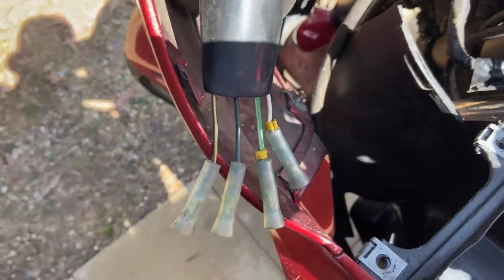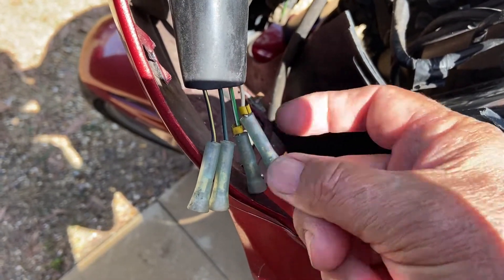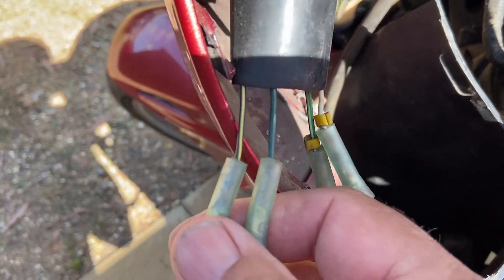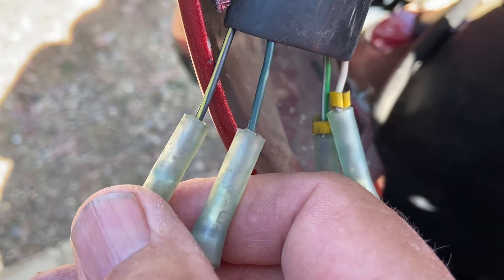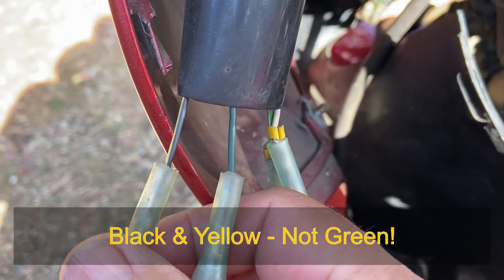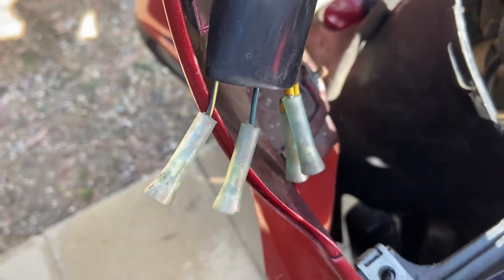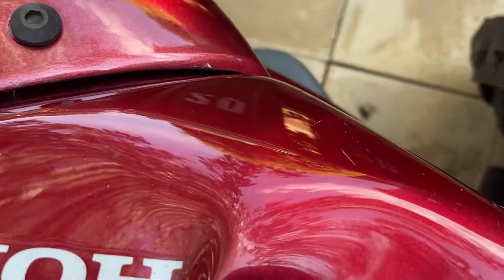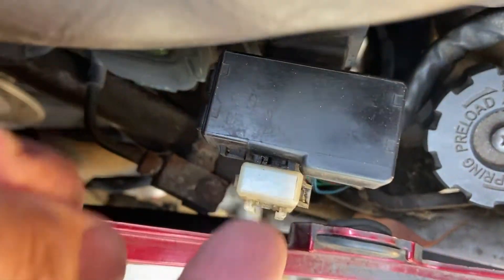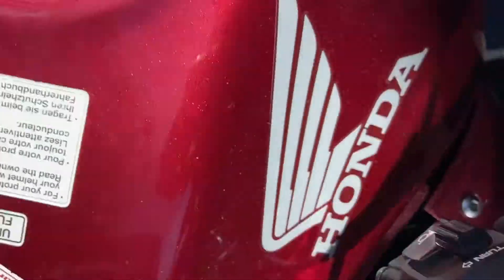That rubber cup — there are two wires that go down the back of the bike; they're for speakers. If you put a radio on your bike you can have speakers front and back. There's a green and black wire — it looks like a blackish blue but it's green and black. The plain green one is live and the other is the earth. If they're not working, they terminate at the fuse box — the live one has a 3-amp accessory fuse. Mine wasn't working to start with and I had to go and find that fuse.